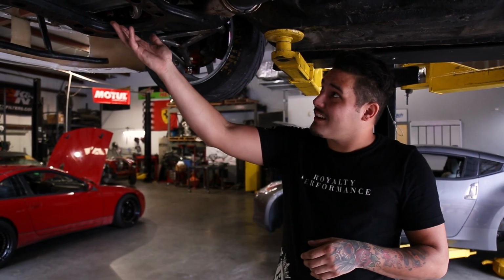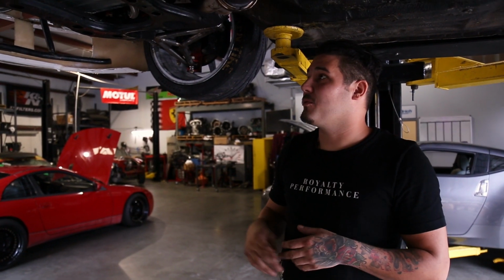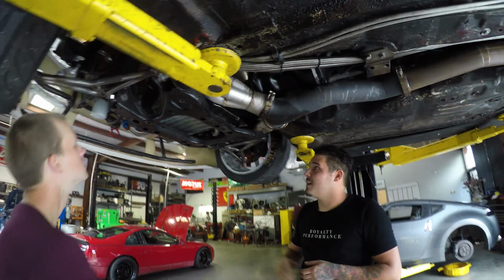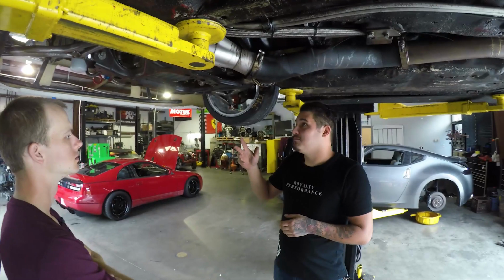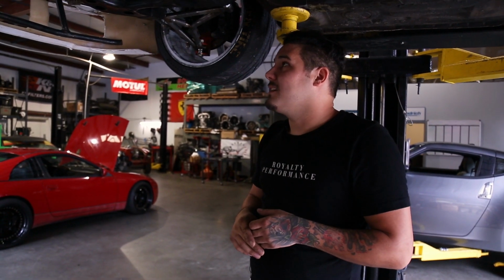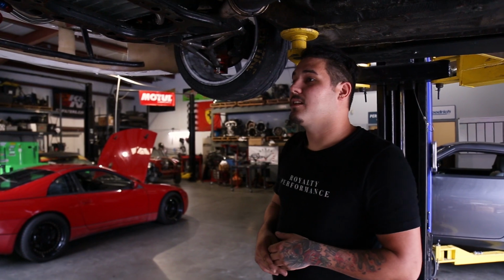Next, it's got a full dry sump oiling setup, like I mentioned before, with fluids being sloshed around by G-forces. You gotta have a good oiling setup on a Chevy LS. I went ahead and built my own dry sump setup, ran a Moroso pan, and pieced together a kit. It allowed me to fit this motor in really low with the oil pan being slim, which made it a lot easier to fit in and perform better with a lower center of gravity.